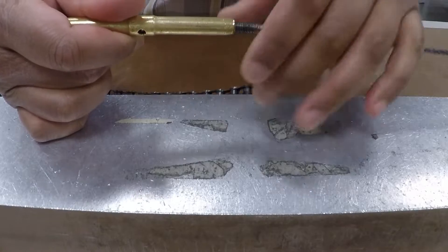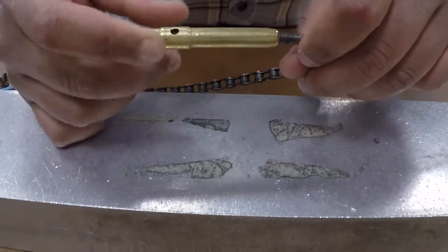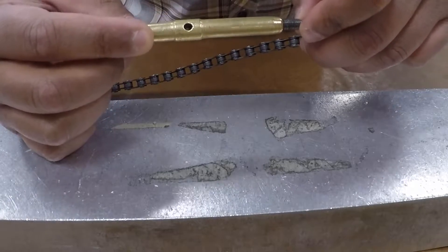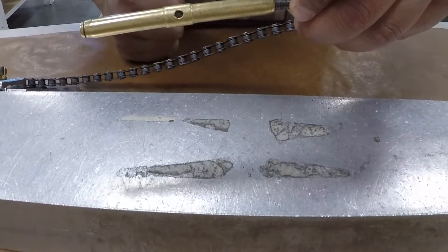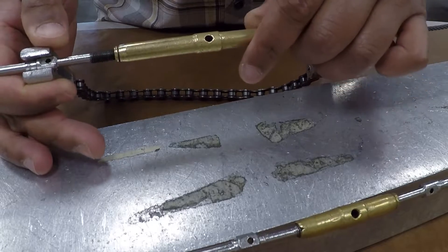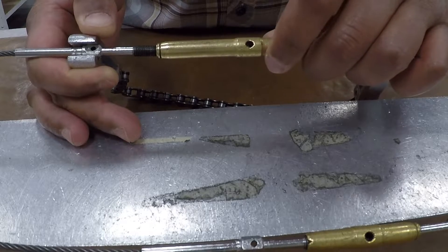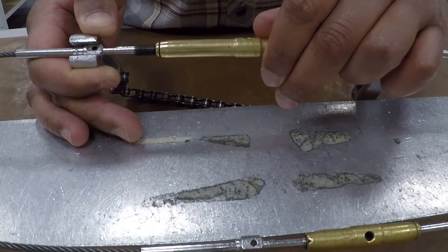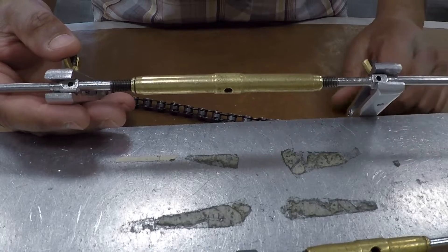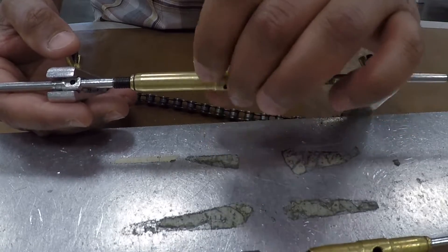So now it bit the thread. I've got basically one to one-and-a-half threads on this side. Then I get my other end of my cable and install the left-hand thread on the other end. Now I've got both ends installed. As I said, AC43-13 says four threads on initial installation, but we can get by with one.